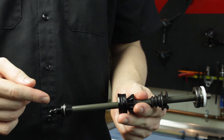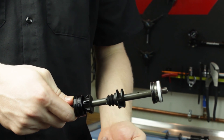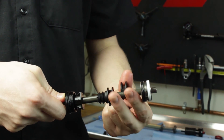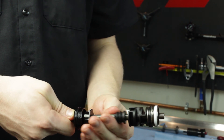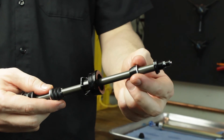If you're changing the travel of a 26 inch Matic, you will have a range of 170 to 140. In this case, we'll be changing the travel from 160 to 140, so we'll be adding two extra spacers to equal three. Note that on this Matic 26 inch compression rod, there is no spacer down by the air valve.